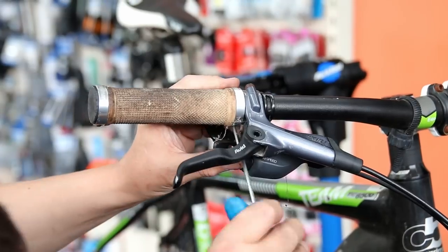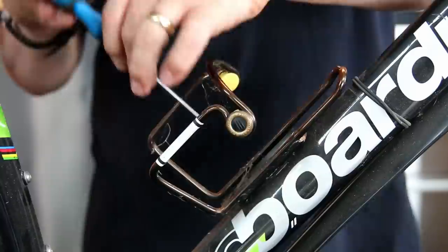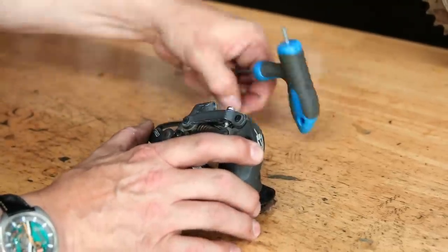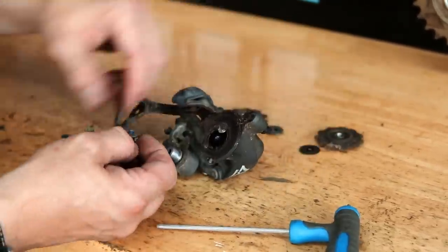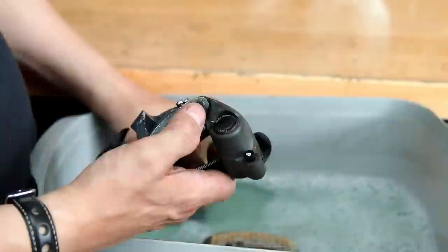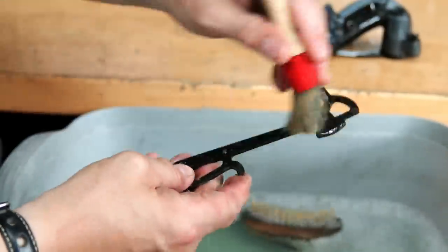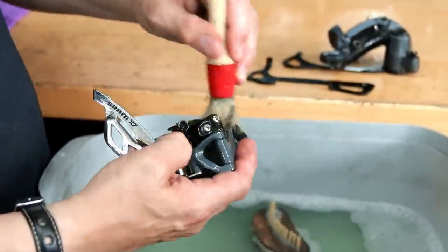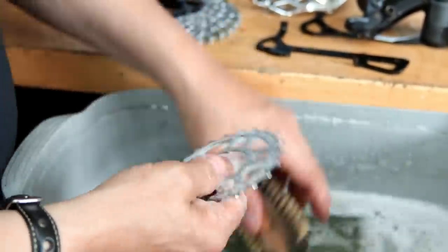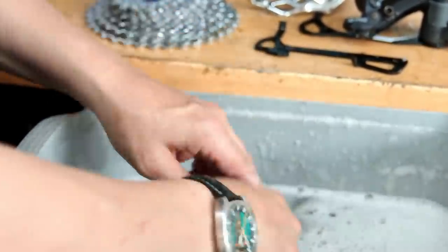We'll clean the back of those pads up. When we were bleeding these brakes — they use DOT 5.1 fluid — I noticed that DOT fluid will corrode paint, and around the brake levers there was evidence of corrosion where the fluid had leaked out. I have a feeling at some point someone may have tried to bleed the brakes, not been successful, and the bike was put to one side. This customer then found our YouTube channel, watched our videos, put that comment in last week, and it spurred him on to bring the bike in.